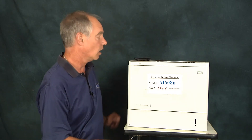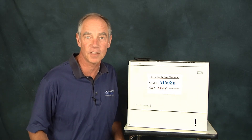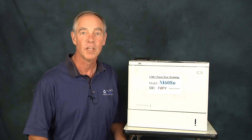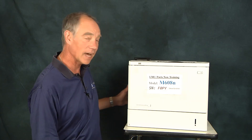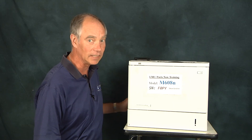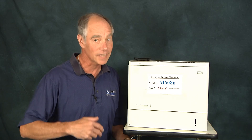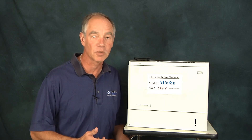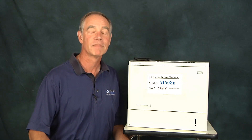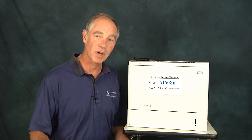Turn off the power, unplug the unit, turn the power back on again. Now if you've got an older technology and it does nothing, well, you really haven't lost anything. But with the newer stuff, I'm turning on the power, I listen to the motor turn over — there was power in there. I can even look at that formatter light flashing, see if there are any little tweaks going on. Other boards, you won't see that. So key in on those little flashes of light to make sure they're gone — then the power is discharged, it's safe to work on the machine and take out the major components, more specifically the logic boards. This is Steve Geissert with another tech tip from LMI Solutions Parts Now.